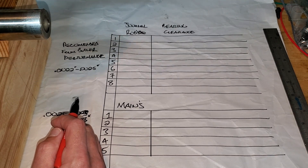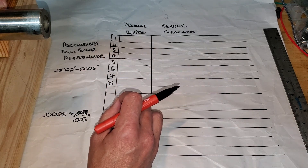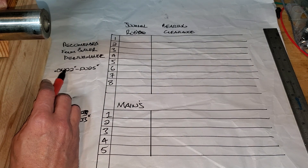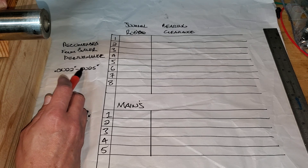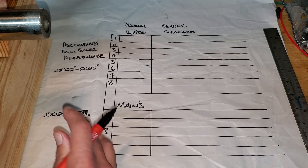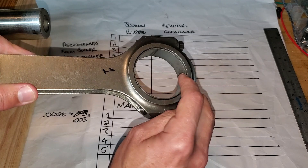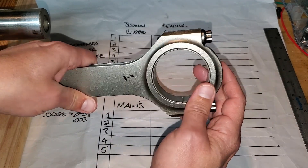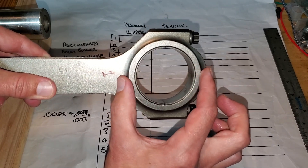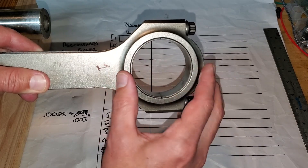You need to research what is best for your engine. Rule of thumb for any engine is typically one thousandth per inch diameter. My rod journals are 2.2 inches, so times one thousandth is 2.2 to 2.5 thousandths — that's my target. As you go up in horsepower, your tolerance needs to get bigger. When your piston is moving back and forth at really high horsepower, this actually elongates from the inertia, so you need more tolerance to get more oil coated on the whole bearing surface.